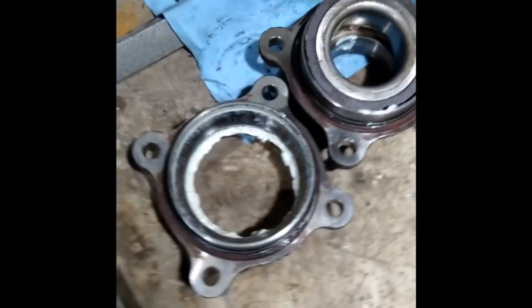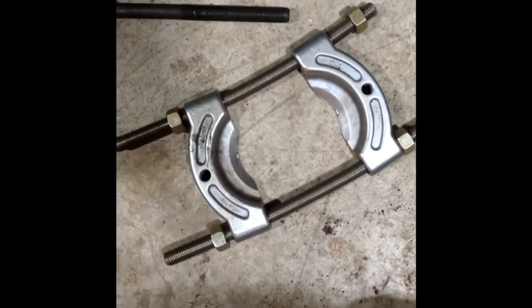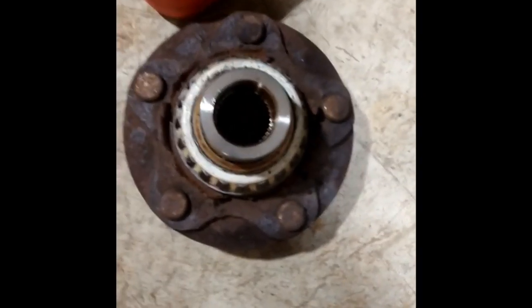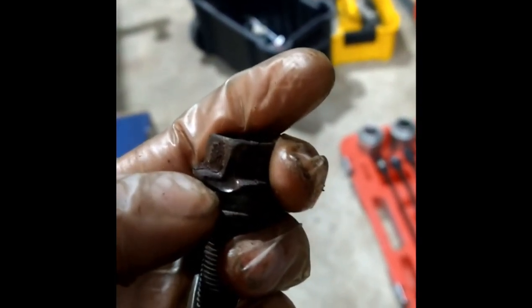As you can see, this is why I bought two more threaded rods — just to get by while I get the right tool for next time. They ended up really bent, but that doesn't matter — it's just a sacrifice threaded rod. Now I'm going to clamp this onto the bearing on each side and press it out on the press. Another thing that happened during the press-out was this bolt washer got a little bent out of shape by the threads. So I'm going to shave this off a little bit with the grinder, make it flat again, and keep on going with the job.